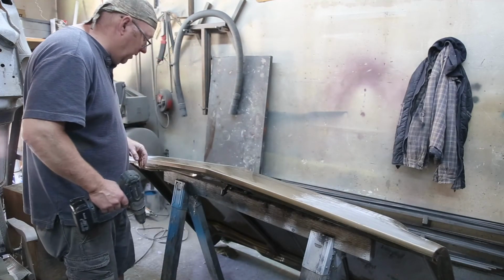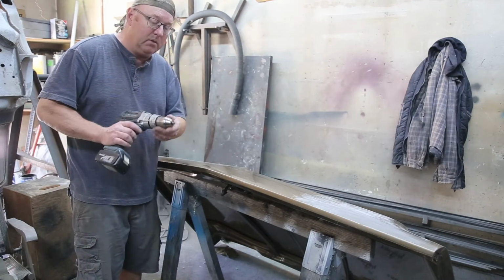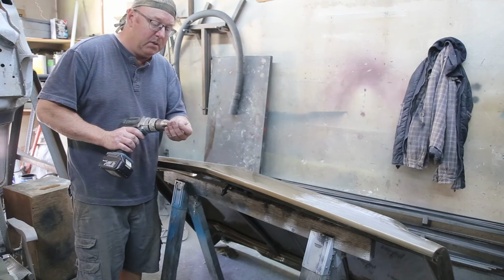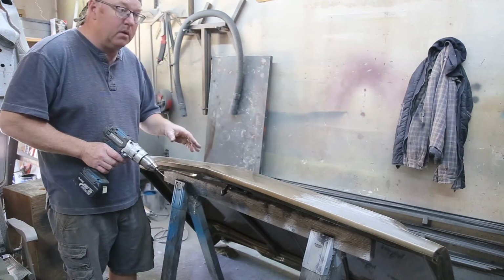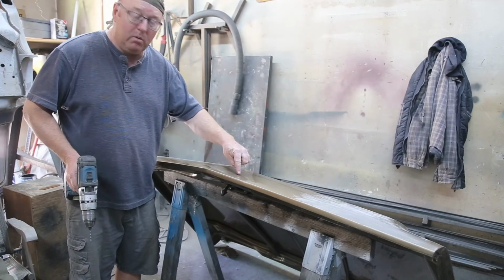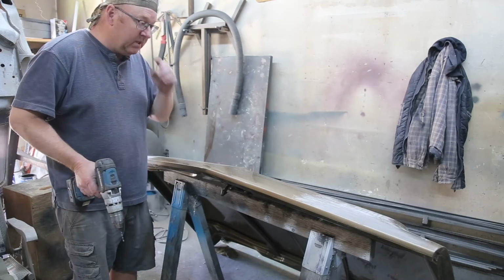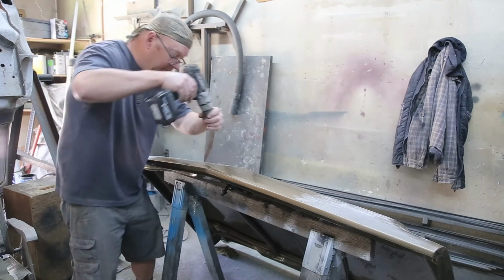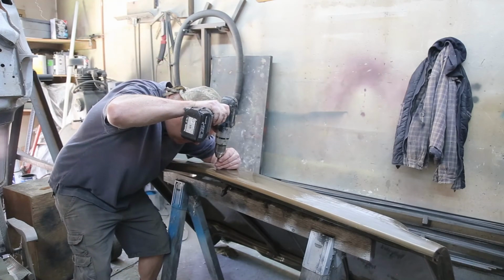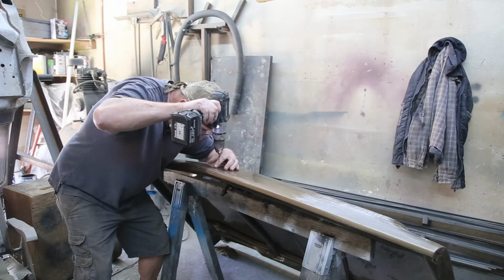Alright, so what I don't want to do is blow right into it with the drill bit I got. I want to use a small one, shorten it up as much as I can, make sure it's perfectly sharp. And we're going to pre-drill these, and then I remeasured the holes. Small one's 1/8 and 5/32 for the big one. So let's get them centered with a small bit, and then we'll make them a little bit bigger. Take your time. Get it started. Yeah, it looks good.